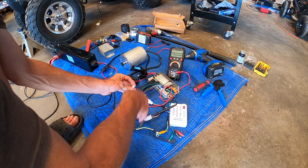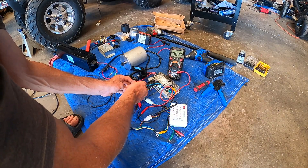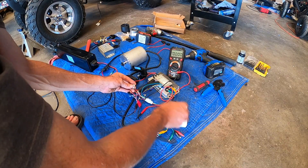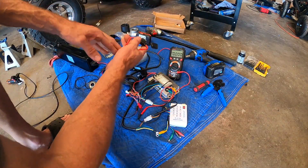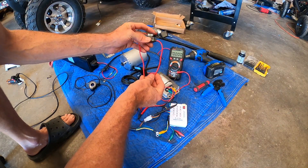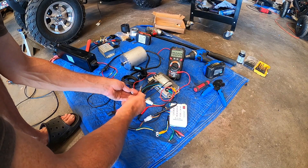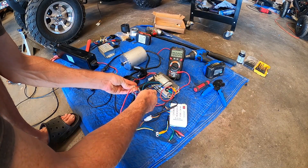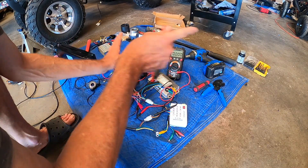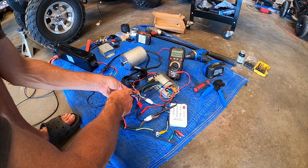Knowing it's only a 5-volt signal, it's safe to short it to ground since it's a functional switch. Get everything wired up and ready, hook up your throttle, then make a little jumper with a low-amperage fuse - something like 2 amps or even a half amp if you're worried. Turn it on, plug the connector in, and twist the throttle. If it goes really fast, it's speed control. If it goes in reverse, it's a forward/reverse switch. If it doesn't go, it's a brake switch.